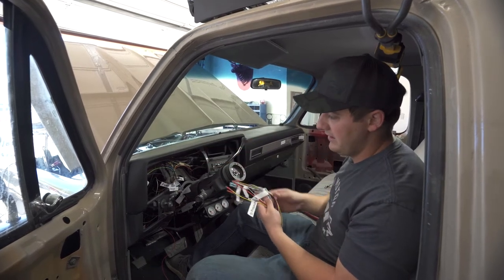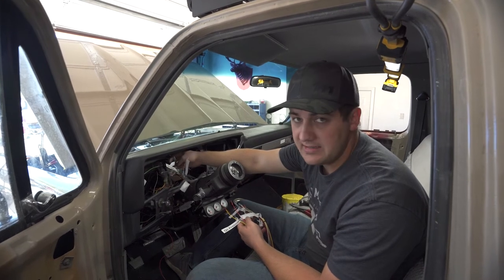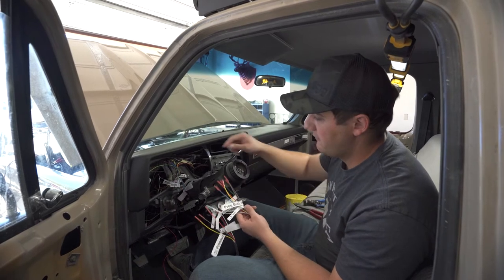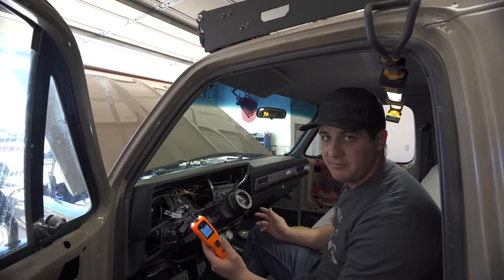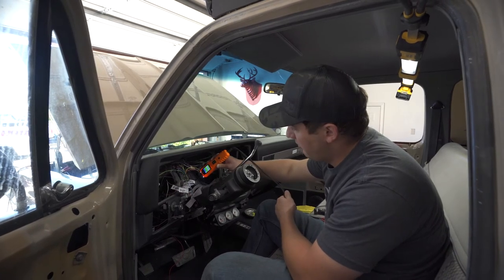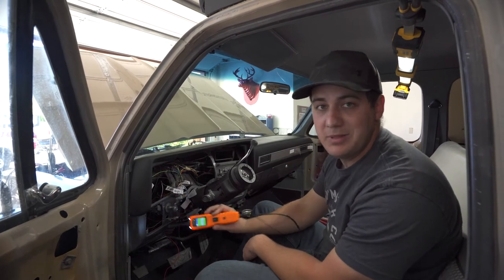I've got everything ready to go to start wiring in here. I also labeled everything on the truck's harness side before making the video. You don't have to do this — you're going to find these by using your power probe. But if you have these already labeled, you can go in, find a wire, butt connect it together and be done. So we've got a power probe — first things first, you're going to want to find ground. Obviously if you have a metal dash and you touch anywhere bare metal, it's going to read ground at 0.0 volts. Painted surfaces won't give you ground — only bare metal. You're going to want to check that this remains ground when your key goes on, it remains ground when your headlights come on, and when your blinkers come on. Turn your key over and put your blinkers on and make sure that the wire is not changing from ground to power. If you don't have a wire like this, you can make a new ground wire by taking any bolt that's on bare metal or making a bolt hole in your sub dash.